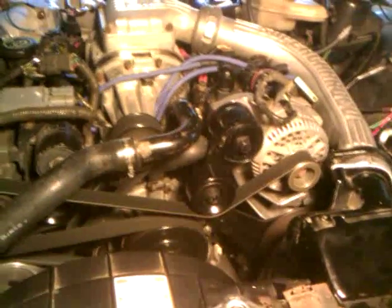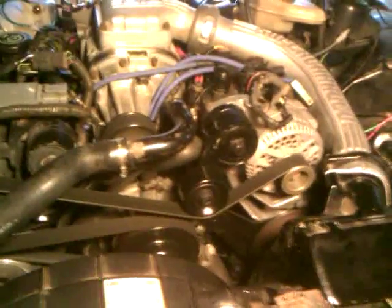What happens is you take them to, I took my powder coater, and they have this tumbler which has these beads in it, and these beads lightly polish aluminum. So it's not traditionally polished, but it gives it a nice satin look, and it's dirt cheap, like a bracket costing like $10, and it looks really good. I did this one on this side. Unfortunately, you're dealing with the jack pulley. I didn't want the granules to jack up the jack pulley bearing.